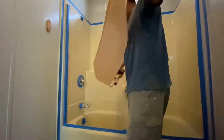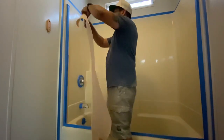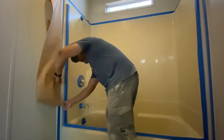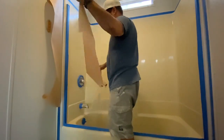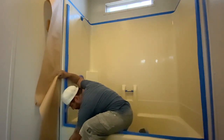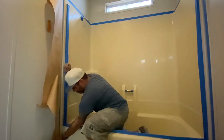Once the perimeter and all of the fixtures are taped off, I'm going to start masking with the 12 inch by 60 yard masking paper — I love this. Some people might use plastic with the masker, but I've noticed that the material when sprayed doesn't kick off of it as much. It works really well with the acrylic urethane that I spray, so I will never use plastic around the perimeter. I will always use this masking paper.